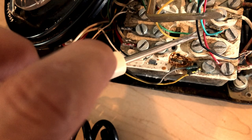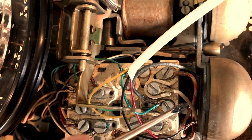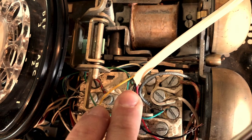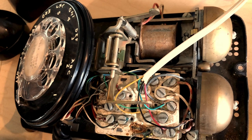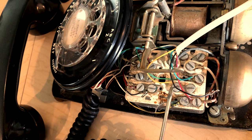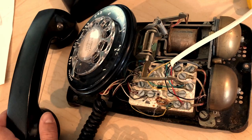There's also a green one connected from the phone and a black one connected from the phone. On this one we've got a white cord connected from the phone. On the last one it's just a red cord from the phone. So to review: from my phone cord, the red one goes here, the yellow one goes here, the green one goes here, and the ground we don't use.